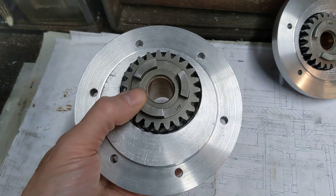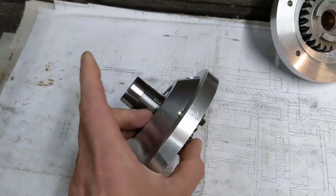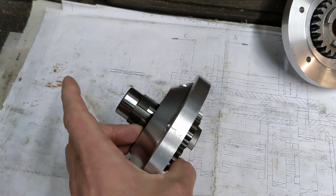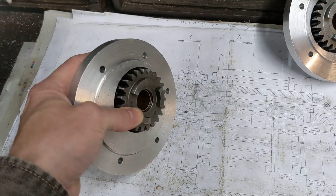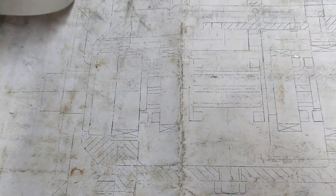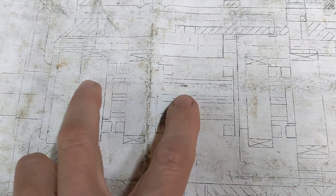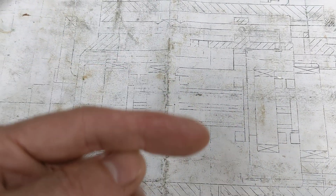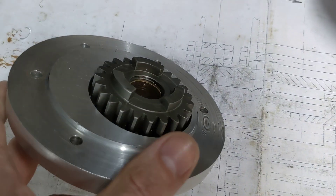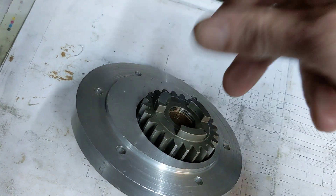It has this dog that runs in a bearing, and the idea is that the shaft runs right the way through the middle of the gearbox, driven by the clutch on the left hand side. As you're looking at the front of the bike, in the middle of the shaft is a long spline, which you can see on the diagram here. On the long spline you have a sliding dog, so the sliding dog is continually rotating. The dog engages with the gear on the end of the shaft, and as it does so it then turns the shaft.